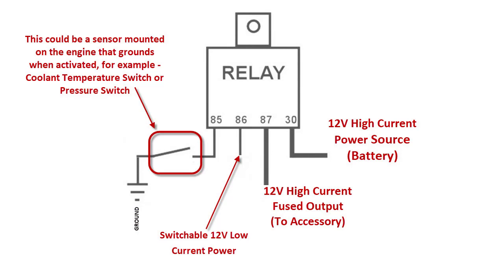You just need a low-current wire — 16 or 18 gauge wire is plenty thick enough. You want it from switchable power, meaning whenever the ignition switch is turned on in the running position, that leg has power. You don't want it to have power in accessory mode, just only when the switch is on and running. That way the fan will only run when the car is running. So when 85 and 86 are engaged and contacts 87 and 30 pull down, your cooling fan will run.